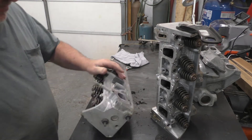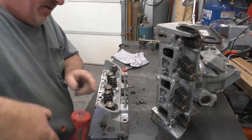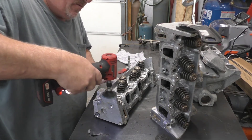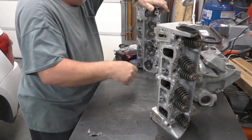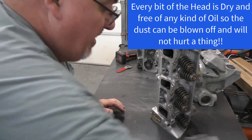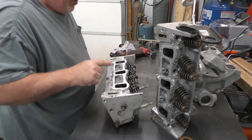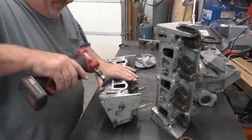This is obviously the valve cover sealing surface — we'll be extra careful with that one as it's very easy to take material off of it. As far as the Felpro head bolts are concerned, these are for different vehicles so you get extra bolts in the kit. You get a lot more bolts than you actually need in this particular case — still got to buy two sets. Very careful because this does not have notches ground in it either.